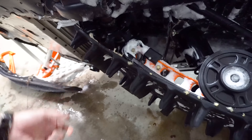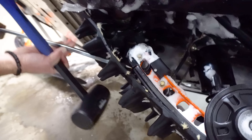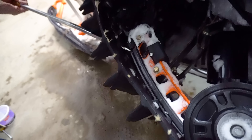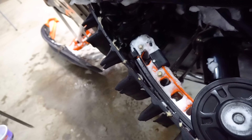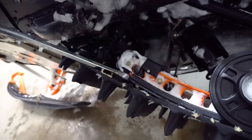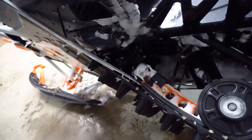This is what we're talking about here — this is your slide, and it's slid onto the bottom of the rail. The rail is shaped kind of like an I-beam, almost like a T-shape, and this slides in there and is what's going to wear down. In the case of an Arctic Cat, it has a Phillips head screw and a lock nut on the top. Z just changed these last season so this is going to come apart pretty nicely.